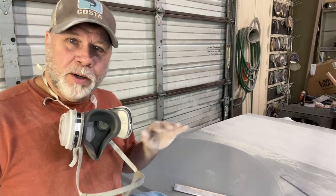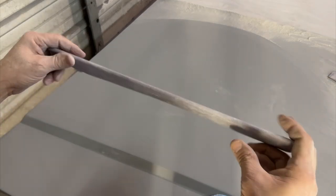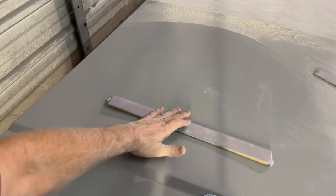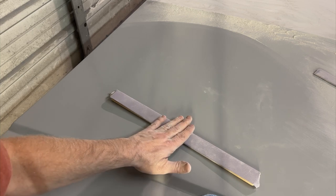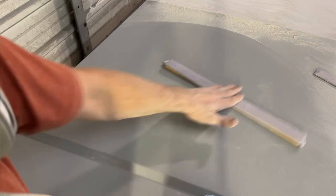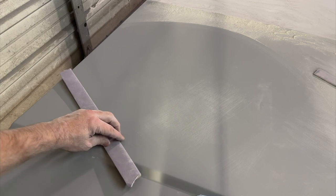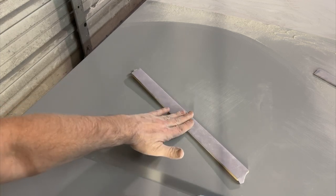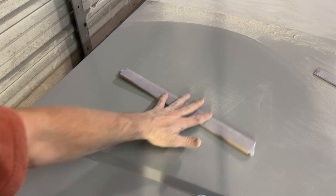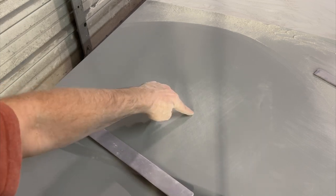But let's get back to controlling our block. So when I take this paint paddle that's fairly stiff, and I start blocking, if I put pressure in the middle of this block, just slight pressure, if I'm sanding, that's the results I get. So, sanding in the middle with pressure, even if it's distributed, one-handed sanding is really gonna concentrate in one center area.